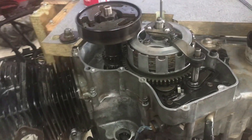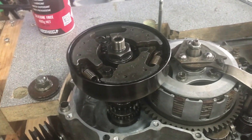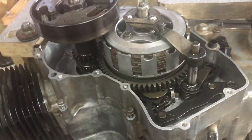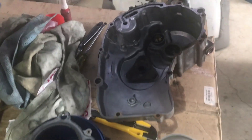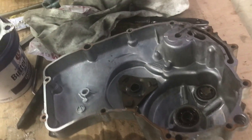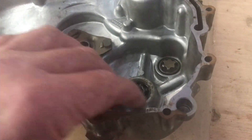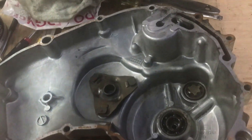I'm happy with how everything on this side has gone back together. The worn centrifugal clutch is really the only problem I'm identifying. The cover is ready to go back on, but the cover has its own minor issues - I was expecting to keep the original gasket because it had come off in one piece, but while I was handling and cleaning it, it started to fracture. So I broke the rest of it away and now need to clean off the remaining material and go make another gasket.